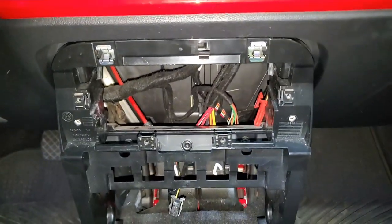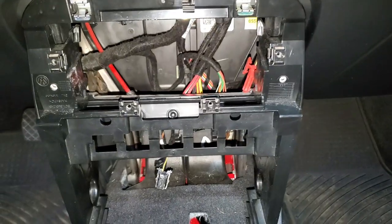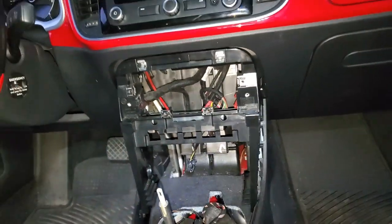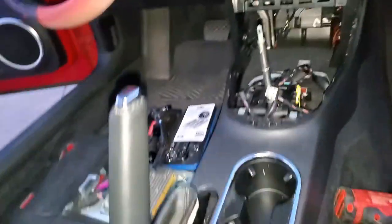Got the boot up and seated down — now we need to move the console forward into position. There's a gap here we want to get rid of. While moving it up, make sure this front piece goes under the console. As we move it forward, make sure it goes behind it. Slide the console up and that's just about all the way in place. With the console in place you can rotate this item up and it'll click into place.